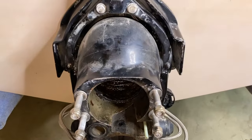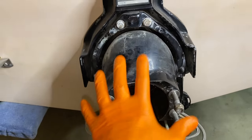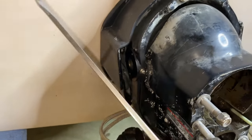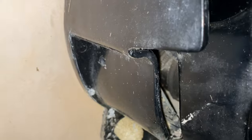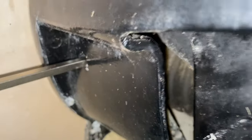Now we'll shift our attention to the bellows — both the U-joint bellow and the exhaust bellow down below, as well as the water tube that feeds up to the top right corner of the inner housing. We'll also transition to the port side, where I've got a very long Craftsman flathead screwdriver. On Alpha 1 Gen 1, Mercruiser drilled a hole right here — you can slide your screwdriver all the way in to make contact with the inner worm gear clamp securing the exhaust bellow to the inner housing.